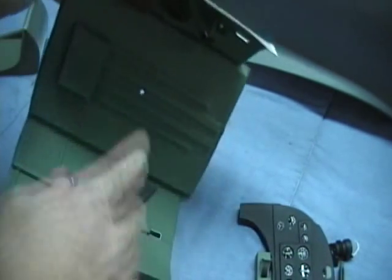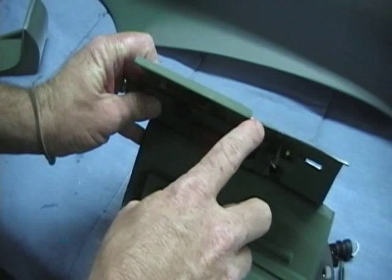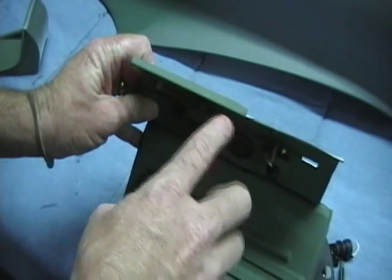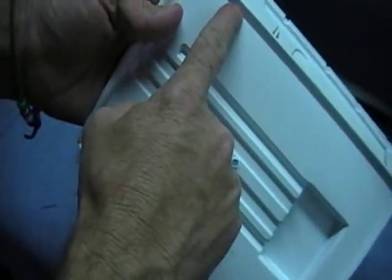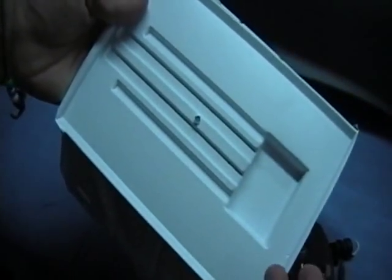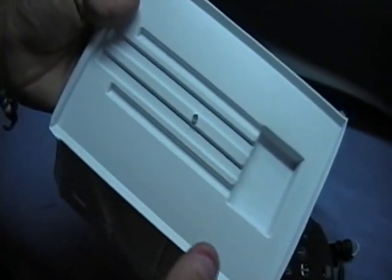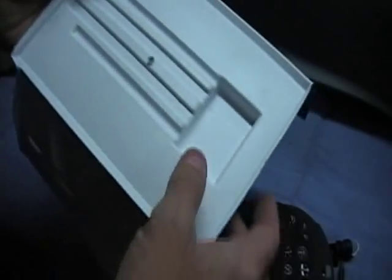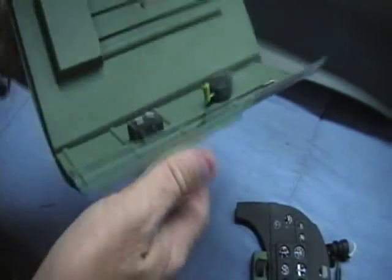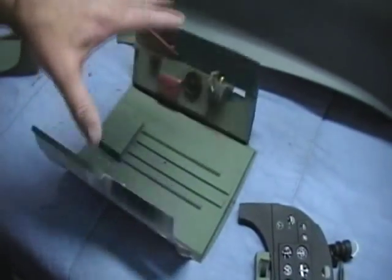I had you move from the back forward five inches, but I ended up cutting that back to four and three-quarters — you just have to trim it to whatever you feel necessary. For the bottom, you need to add two stringers across. On the last one I did, I used a quarter-inch by half-inch piece — the full width — of light aircraft ply. You need to go ahead and put those on there; that'll stiffen it up, especially if you're going to put a pilot on here.